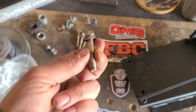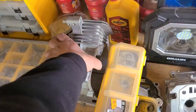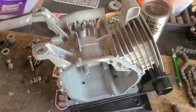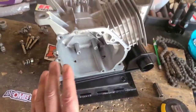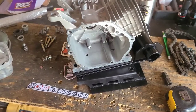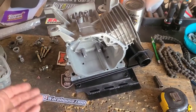Since I have the hardware to assemble this thing with the engine in place, I'm gonna use a spare 196 block that I have kicking around. I'm going to bolt all of this on just like I was gonna mount it on the mini bike for good, so everything is in proper alignment to where it's gonna be when we get to that point.